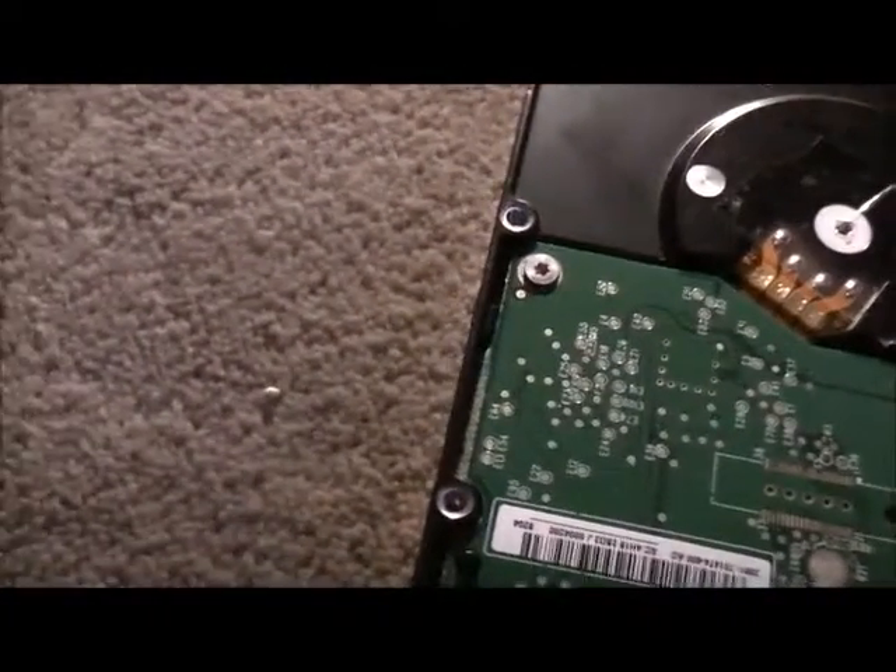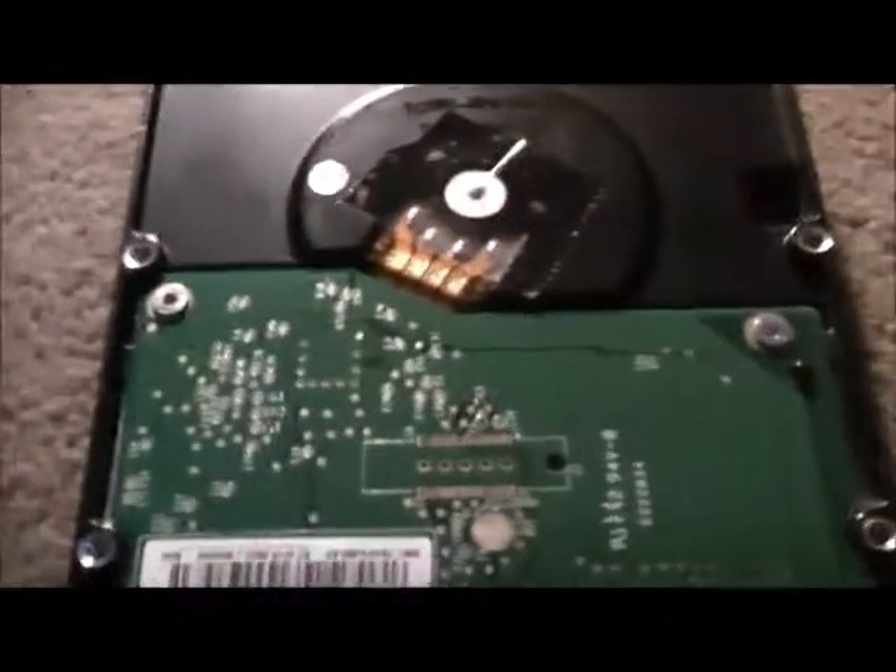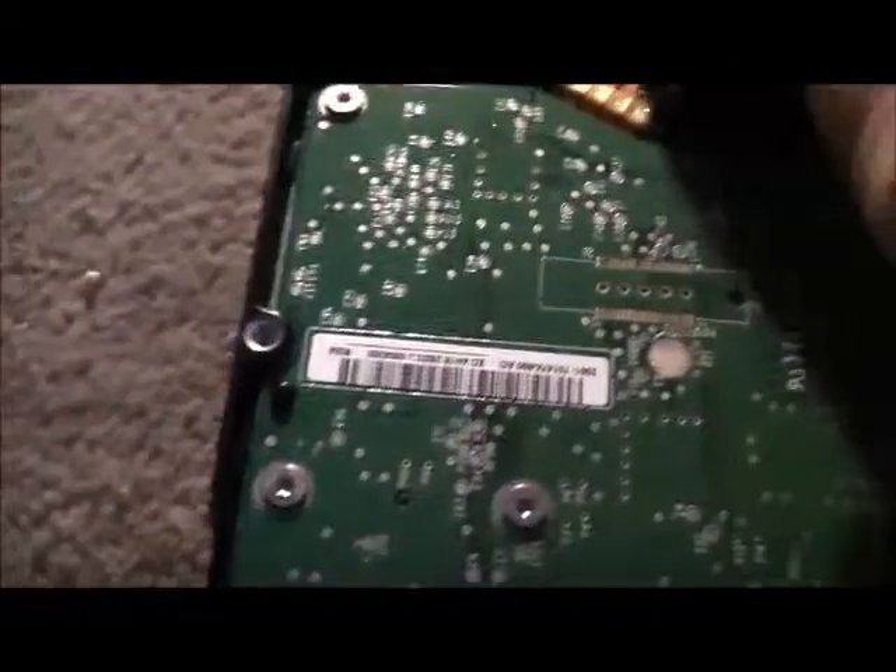As to the Seagate one, before I turned it into a massager and completely killed it, it would have let me reformat it, so it was in its pre-failure mode. On this one, I did some HDD regeneration and ran other programs that claim to fix HDD bad sectors — proof to myself that they're snake oil. Programs like HDD Regenerator actually make your hard drive worse.